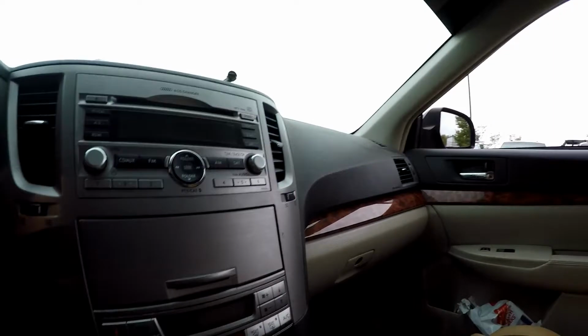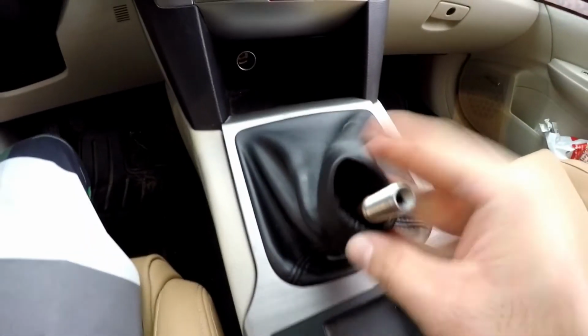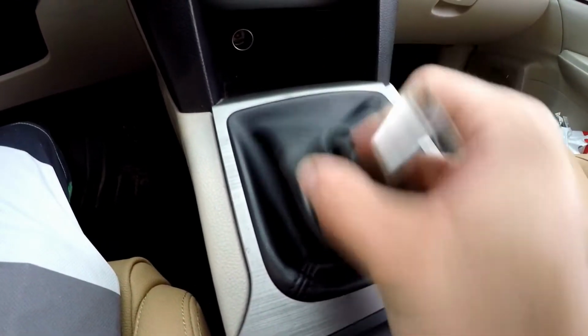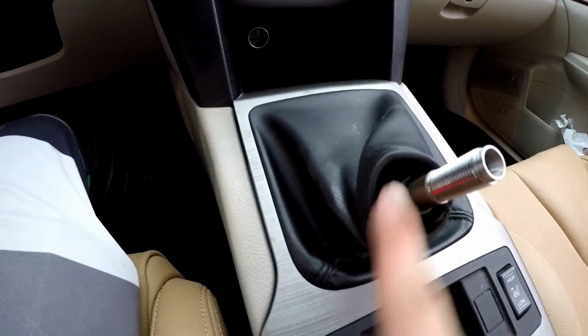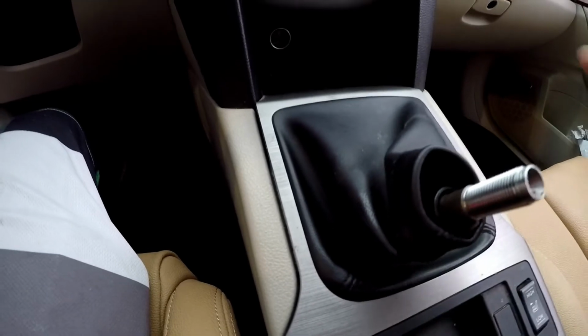So Jake and I just got back from taking it for a quick little rip. For the most part, it was good. I liked the clearances, except for when we stopped at a light, and I think it got worked in a little bit more. Second gear, for this reverse lockout part. Every time I put it in second, you might not be able to see, but this reverse lockout thing would actually get moved up. You can feel it moving up. So I don't really like that.